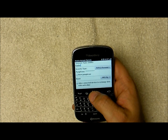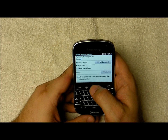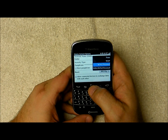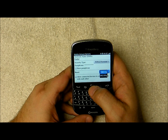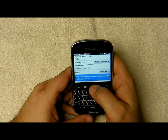Here is where we can name your SSID whatever you want it to be, and then you can select the type of security — whether you want WEP, WPA2, or WPA and WPA2. Then you can put in your passphrase, and select the band — either 802.11G or B/N/G.